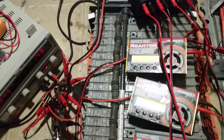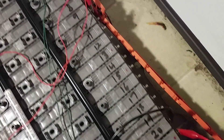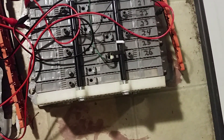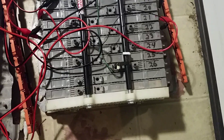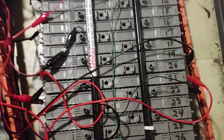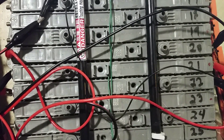To make it easier on yourself, you go through and number each one of these cells. If you look closely on this pack, I also put red dots along the sides of the module so I wouldn't get the polarity wrong. The last two modules you see here that are not marked are bad — they're just there as filler, because you never ever charge these batteries without the compression on. Those bars and the two end plates keep these batteries from swelling.